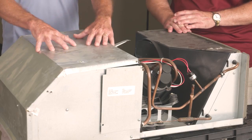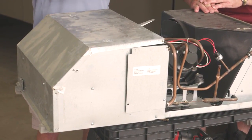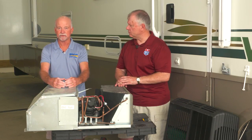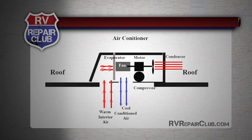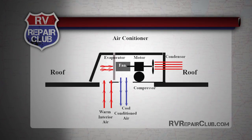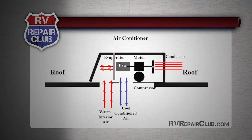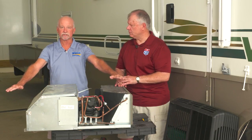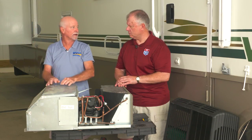What's happening is inside the evaporator, down at the bottom, on this particular unit, you have a discharge duct which lets the conditioned air go into the cabin or the area you're trying to condition. On the outsides of that duct, you have return air. It's bringing up the return air, washing it through the coil of the evaporator, which pulls out moisture and drops the temperature — it actually just pulls the heat out, which drops the temperature. Then it discharges through a small duct, either through the louvers in the ceiling or through the entire ceiling assembly via ports on a ducted roof system.